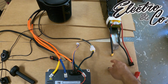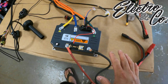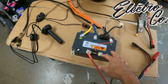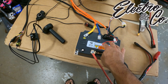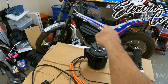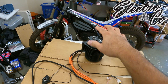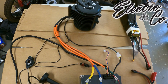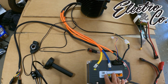I've got my 50-volt battery pack over here. Now this battery pack is not exactly what you would use for this system - this system is 72 volts, which I've been told will give you the max power output. You can tune it to 28 kilowatts, and that is insane. The electric motion right there is maxed out at 11 kilowatts, and this thing at 140 pounds will flip itself end over end with how much power it has. This controller and motor combination with a 72-volt system can do up to 28 kilowatts. That's crazy.